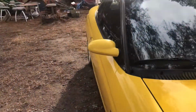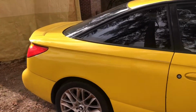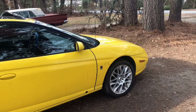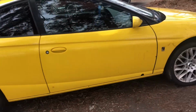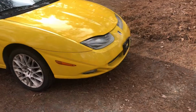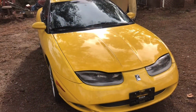So we rented a dolly and got it. So hopefully, next video, we'll take it apart and get that slave cylinder out of there and get that piece out of the bell housing. If not, we'll separate the engine and bell housing and get that out of there. And we'll put the new slave cylinder in there. We'll do an oil change, and we'll see if she fires up.